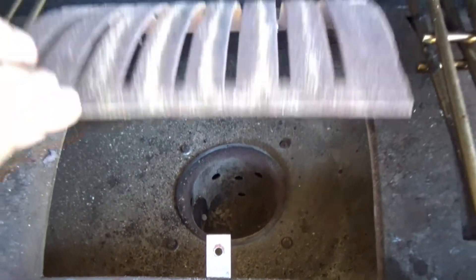Con number 5, and actually one of the biggest for me, is having to clean out the ash pot. I'm used to maintenance on a smoker, but it's more of a pain on this pellet smoker. You have to remove three grates, then the searing grate, then the heat deflector, and then you can find the ash pot and vacuum it out. I did an upgrade — you're seeing a clip of it now — which makes it much easier. I've heard that newer PitBoss models let you clean the ash pot from underneath the grill by unscrewing it so it drops out, but my model doesn't have that.